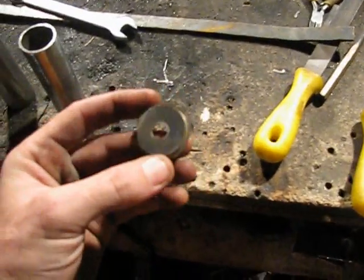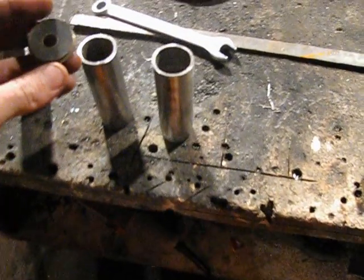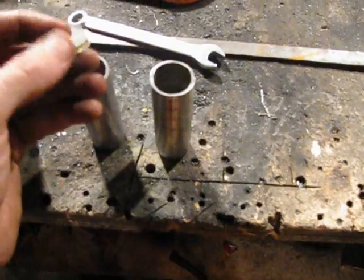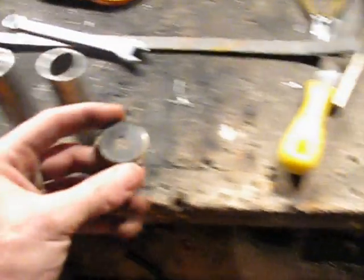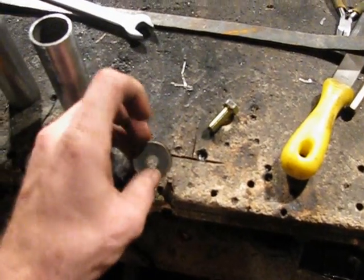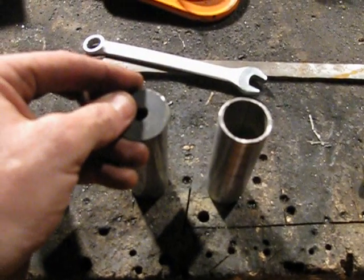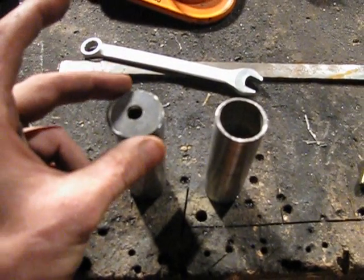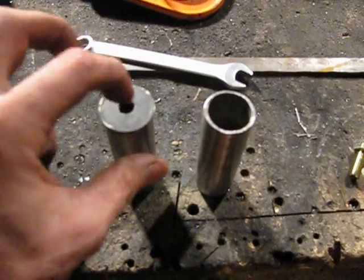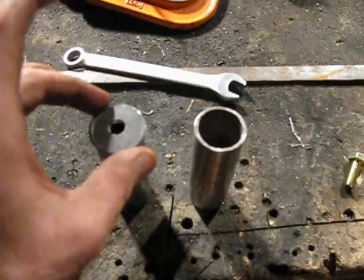So what I did is I took out my hole cutter saw, put that on, then took some flat stock and cut this piece out, and then drilled the hole big enough for the bolt which goes in the end like that, and then weld this on the end. Because if you know how the axle is set up, it's got a drilled and tapped hole on the end — it's not threaded through, just drilled and tapped.